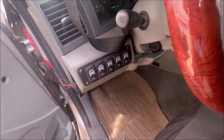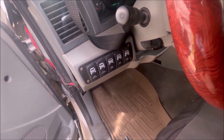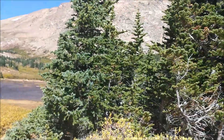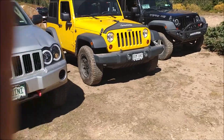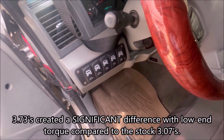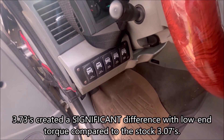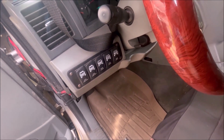I did eventually make Billmore Lake — that trail I always talked about as a teenager, trying to get to the top. I actually did make it, though I felt like my channel was kind of dead at the time. I made it up there thanks to these lockers and 373 gears. With Quadratrac 1 you're running 307s, but I pulled front and rear ELSDs from the junkyard and those came with 373s.